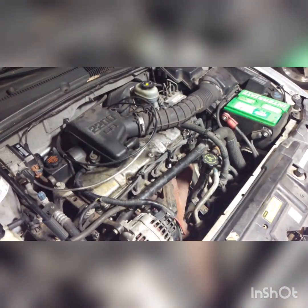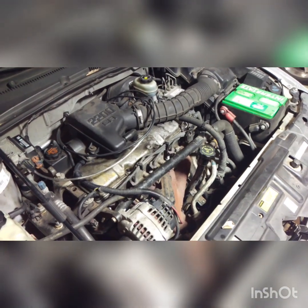Okay, and we bolted the head on like that, and then we had to put the push rods and the roller rockers in. And what was the torque spec for the roller rockers? It was 22 foot-pounds. Okay, and we got all that torqued in and everything done, and then we put her together. Oh, let's get that focused. Yeah, that took a little bit right there.